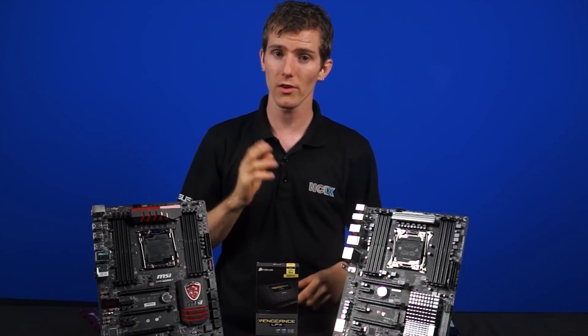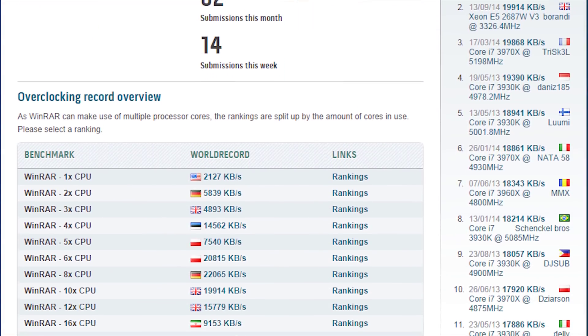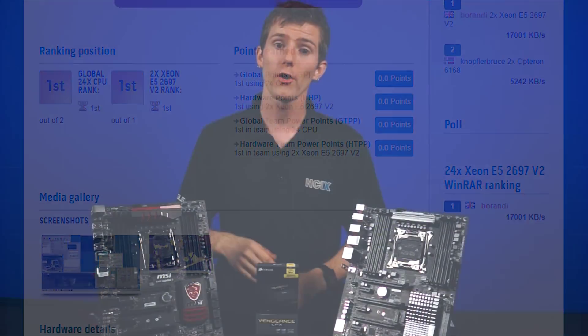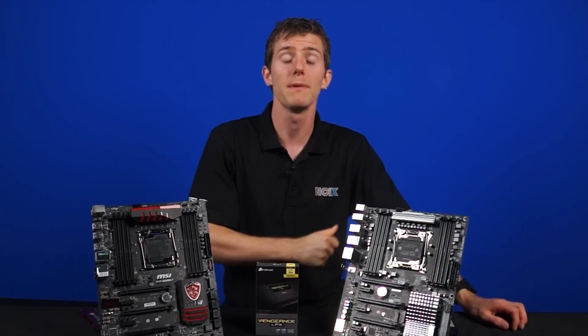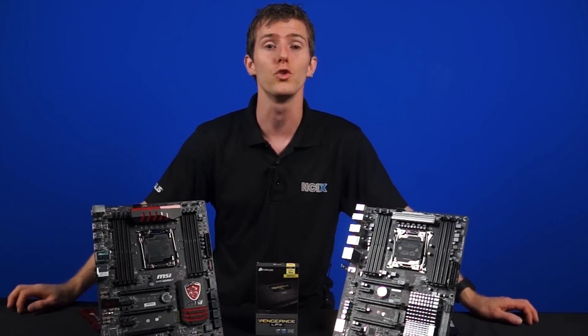We also checked out some leaderboards and noticed that clock speed and the number of threads did not necessarily equate to a higher score. In fact, this system is even beating a 48-thread dual Xeon processor server. The score isn't based on storage speed either, so this is definitely a good indicator. The results tell a similar story in AIDA64: the DDR3 system reaches a maximum of 28 GB/s read and 29 GB/s write, but DDR4 absolutely blows it out of the water with a maximum of 49 GB/s read and 37 GB/s write — bearing in mind that X99 runs in quad channel compared to Z97's dual channel.